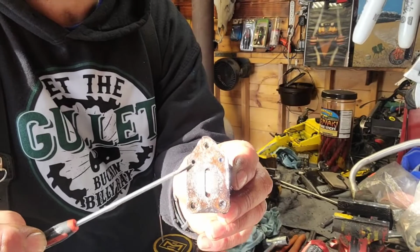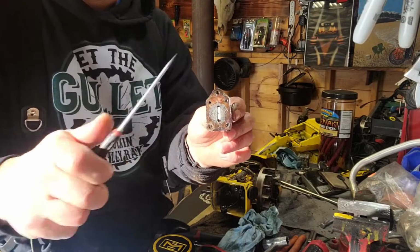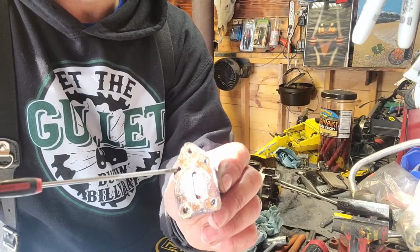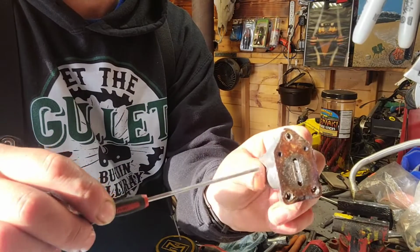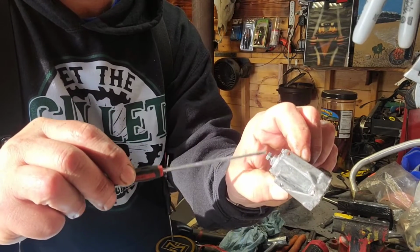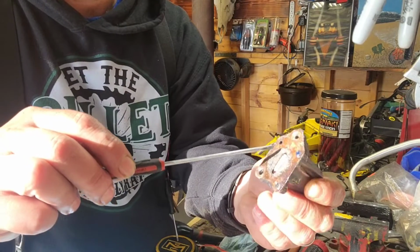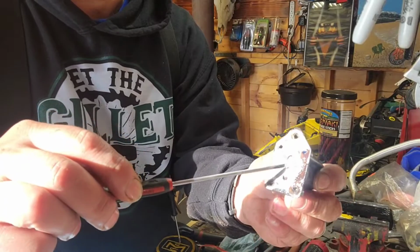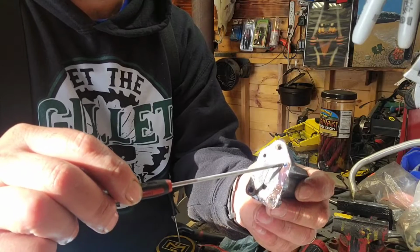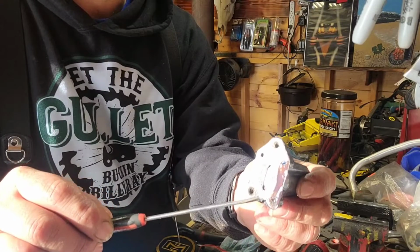It pulls oil in through this hole. When you run your manual oiler, when you run the plunger with your thumb, it pushes oil through here, and then it goes through all this system down here, and through the little ball valve down in this part that this screw adjusts in and out for the amount of oil that comes out. It goes in this hole, and then when this pumps, it pumps oil out that. And you can see it right now. See it running down there? See that? It's pumping oil.